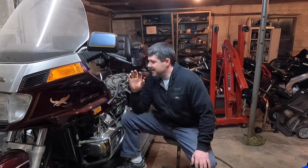I did briefly see a pulse generator not putting out a signal. So I am hoping that putting this back together and pretending to finish it tricks it into breaking again, and then I can catch it. But like I said, right now it's working perfectly fine. So I'm just going to move on to other tasks, and I'll keep starting this thing throughout, and we'll see if we can get it to duplicate that problem again.